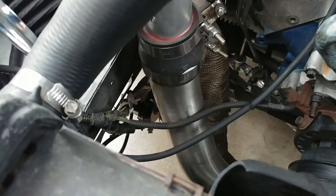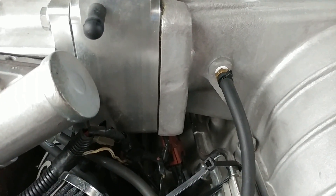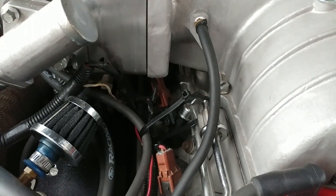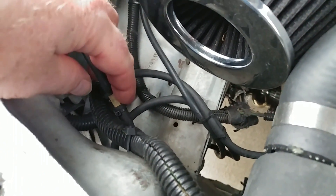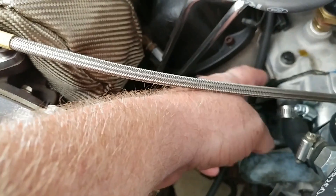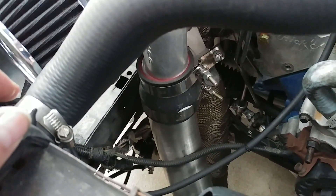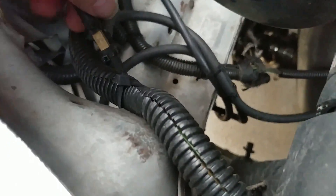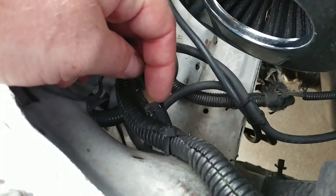For the wastegate — you can see down there, that's your wastegate — I have a vacuum line coming off my intake here, pretty close to the throttle body, got it coming all the way down and going up to this T. The ideal is to run that vacuum line off the turbo, but On3 does not warranty the turbo if you tap it, so that's why I ran this route.